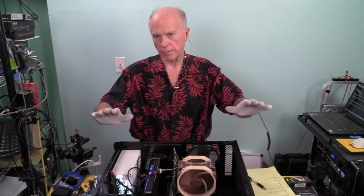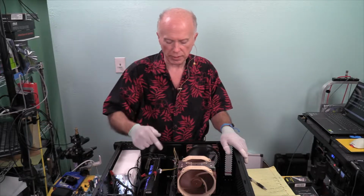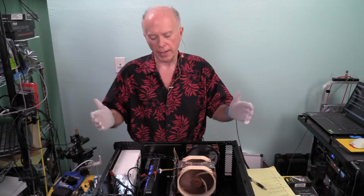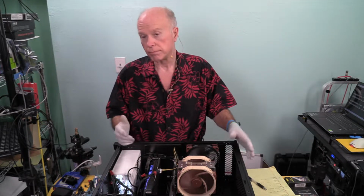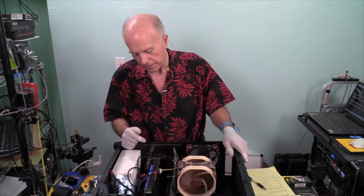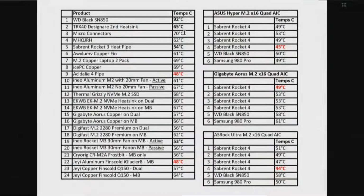And for those that are going to comment about, yes, the lid is off, that's the way we test. Yes, if you add fans, it would change things. We talked about that in the beginning. If you put a couple of nice big fans on here, larger fans move more air and make less noise. We're using stock. Everything on here is stock. And so far, so good. So for what it does, for what it gives you for capacity, remember, that's 6 drives on one 16-lane slot electrically. That's pretty cool.